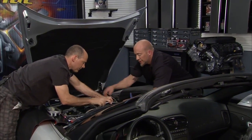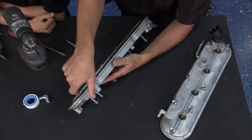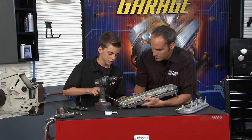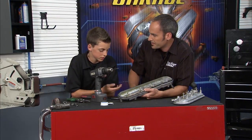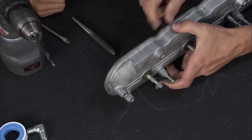We pull off the fuel rail and get ready to go. For the turbo oil return, the valve cover is the easy place — much easier than pulling off an oil pan. We've got our PCV running through a chamber here with a little cover staked on. First we pry this tab open, pull these two off, then snip it to the pattern we've made. We bend the part down, sealing off this chamber so no oil gets in there, keeping it all separated from the PCV intake manifold.